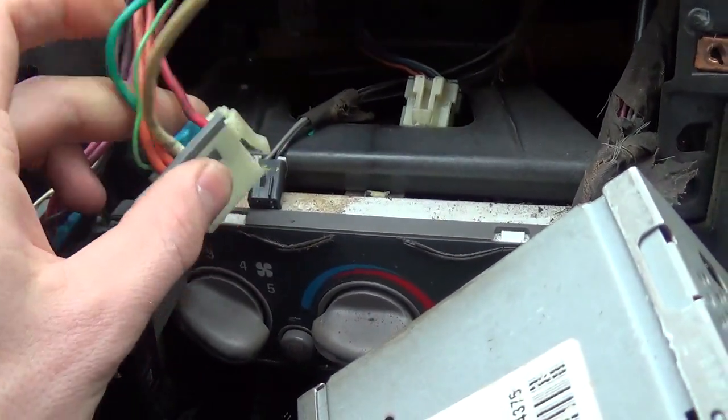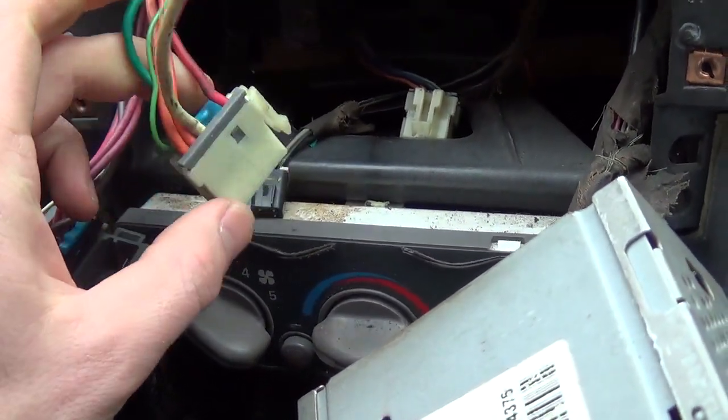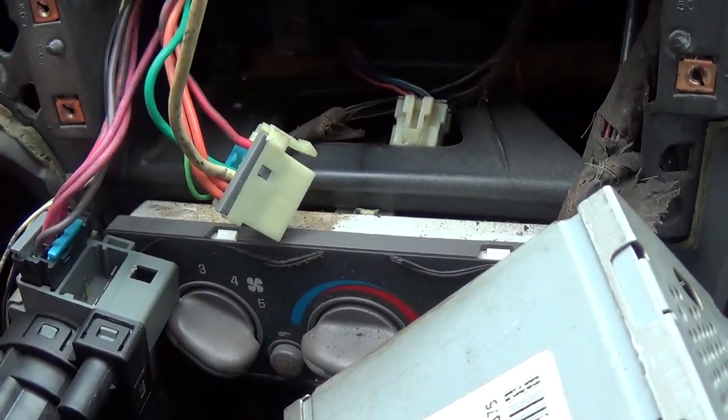So we just need to track down these wiring colors and see what that fuse feeds and find the source of the problem — where this current's going. I don't want to blow any more fuses; those 40 amp fuses are pretty expensive. I'll show you a method I use to track down these short-to-ground issues. In this case hooking up a little test light — 200 milliamps — that's not quite enough current to track it down. I want something a little beefier, so I rigged up a beefy test light, like five amps. I'll show you how that works. Let's look up some wiring diagrams and go from there.